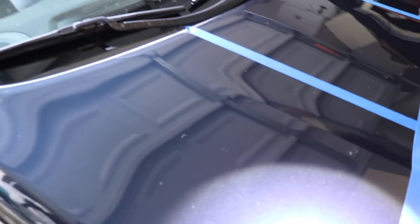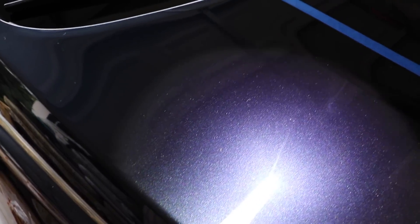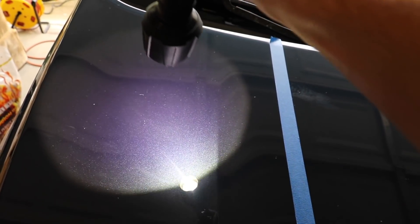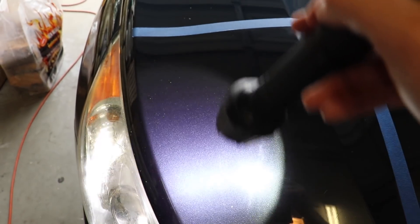I had to move inside because of the rain. Let's go ahead and look under the LED lighting at this first panel that I did with the Overhaul 1000 heavy cut compound. You guys can see there's definitely some buffer tracks because I used the rotary — anytime I use the rotary I'm going to follow up with a DA to perfect that. But going from this uncorrected panel with all these swirls over to this one treated with the heavy cut compound — it certainly looks much better. However, you never want to stop here because it's never going to be that high gloss experience. Here we just have some buffer tracks, but those swirl marks are really getting minimized.